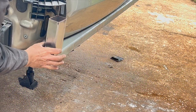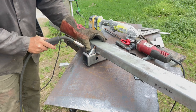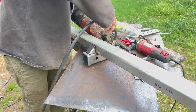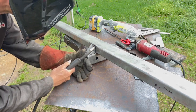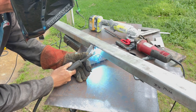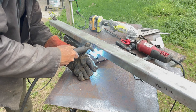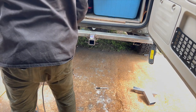Once we've got that angle, we can put in the cross tube. On one side is going to be the hinge and on the other side the latch mount. We're going to be putting in a receiver tube here, bracing it in with some gussets. I just buy a receiver tube on Amazon — they're usually about 20 to 30 dollars depending on the size. This one is nine inches long because I wanted enough forward of that cross tube to put a gusset in there. We get some welding going on in there, weld it in nice and securely, then brace the entire tube up into the inside of the frame rail itself.